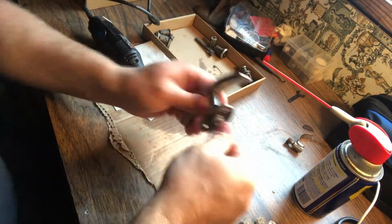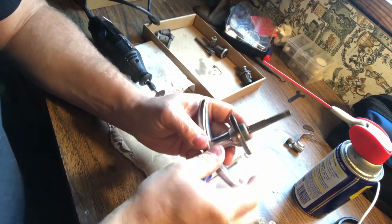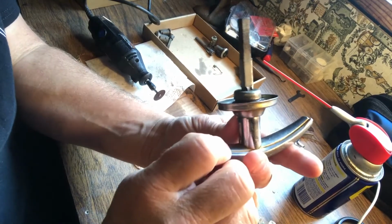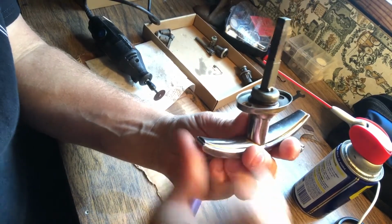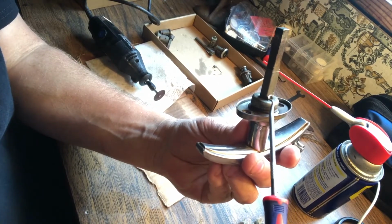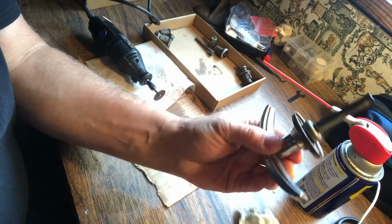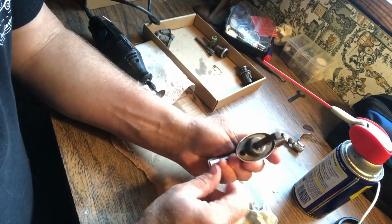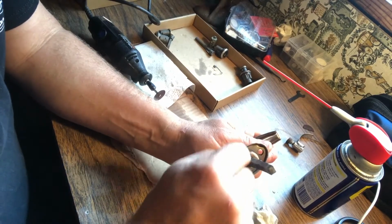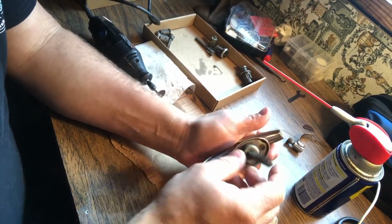Now for the T-handle. This T-handle wasn't made to come apart. You can kind of see here, get a good light on it, that this area has been crimped over by a machine. These pinches on this side, little pinches on that side. Everyone I've seen online, T-handles where people do this, there's always some screw here. They loosen it and they take this thing off and then the cylinder comes out. I'm really hoping that's what happens here.